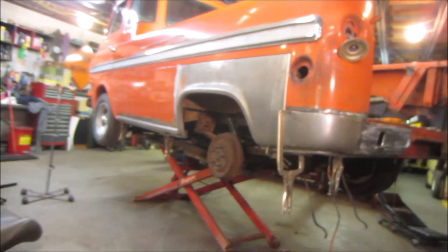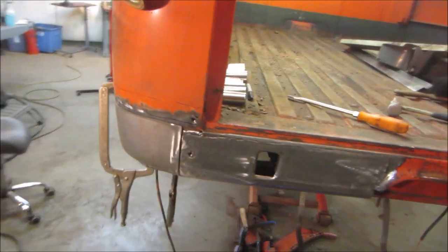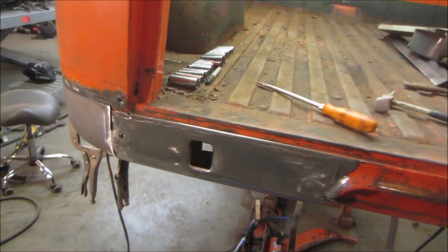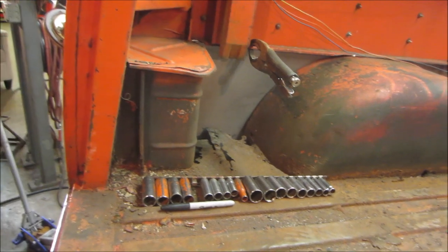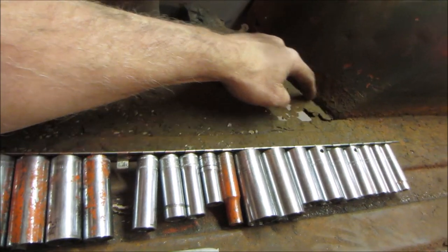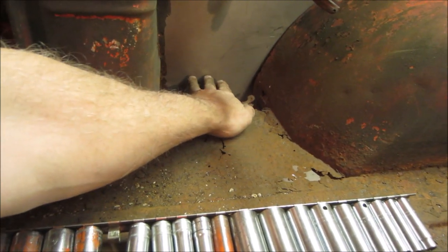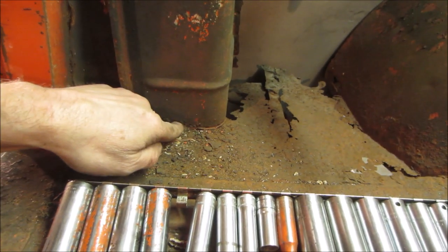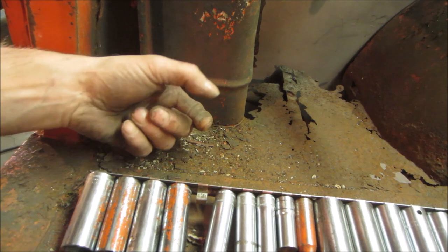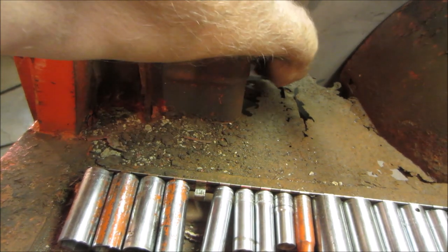I would say the bottom of that truck looks a lot better than what it did. And see how, if I didn't weld this, I really should have. This should have gotten done when this corner got done, but oh well. I'll make this piece. It actually just overhangs on here. It's got a lip. We got to bend down for the wheel, catch the wheel well. Probably a lip to bend down will catch the quarter panel. I think it just slips right underneath this thing, from what I saw underneath. I think this has a flange on. Unfortunately, I think that was kind of spot welded together. So maybe we'll just clean the edge back and we'll try to grab a couple of tacks out here.